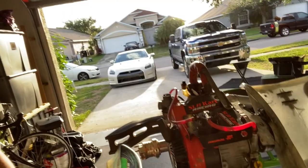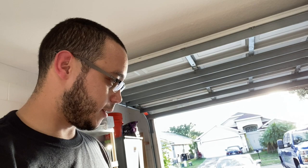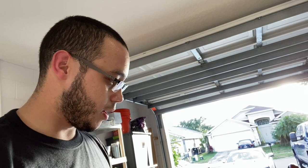All right, so I have the motor on the upper base already. It's nice and tight. You should probably do this off the cart, but just for the sake of the video, and because you never know where you'll have to do this, I said I'm just going to do it while it's on there. With my setup and the size of the bolt, you definitely want to start on the rear left side, not the inside bolt first, so that you have enough clearance to get the nut through when tightening them all on. Other than that, it was pretty straightforward, just tighten it on.